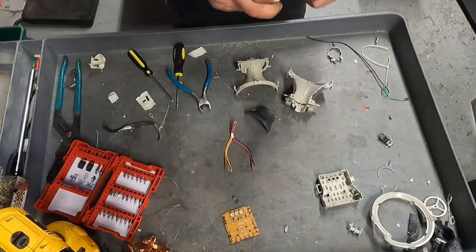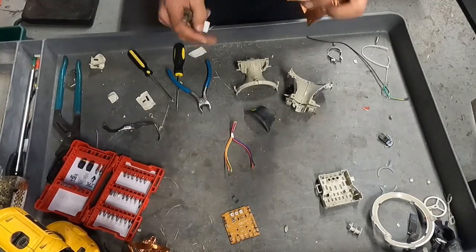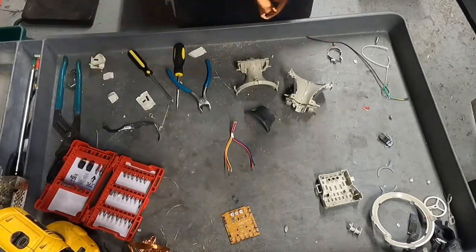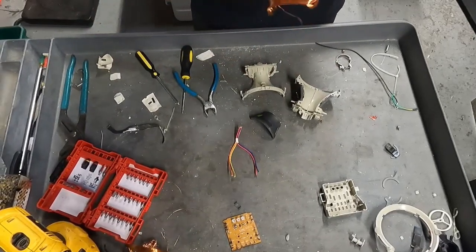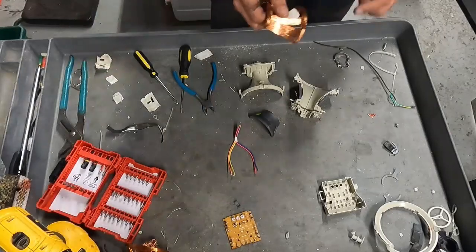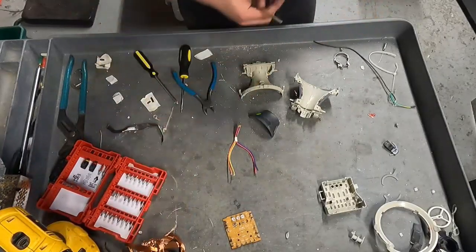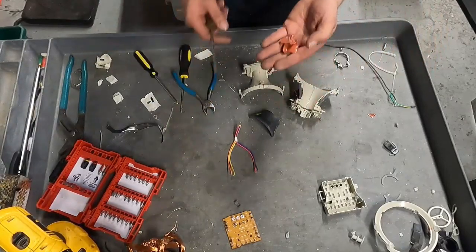So, just got a little bit of tape here. This will actually burn off in the furnace, but I do try to get as much adhesive off as possible, just because it's hazardous. And you should always make sure to use a respirator if you're going to melt this kind of stuff. I'm a casting channel too, so that's why I'm saying melting. But if you're just scrapping monitors out for copper, then just leave it as is.